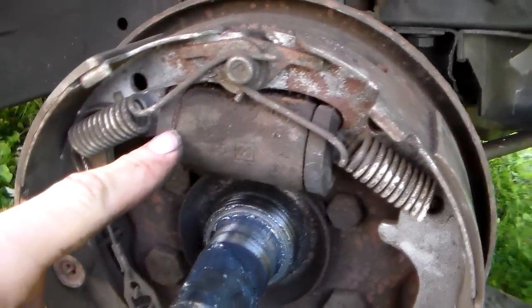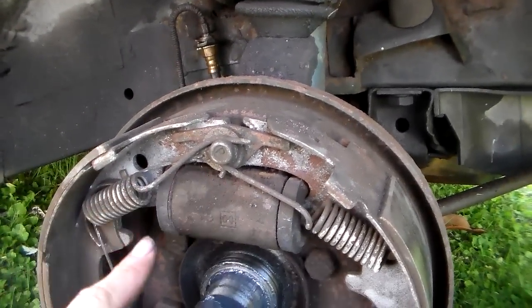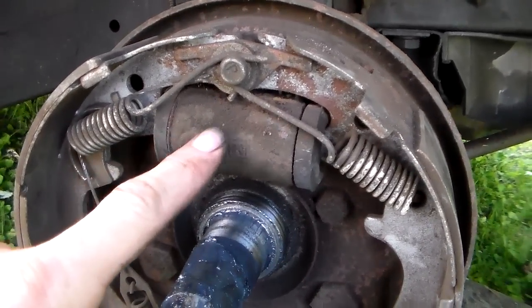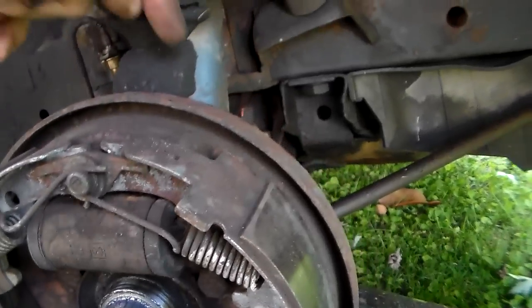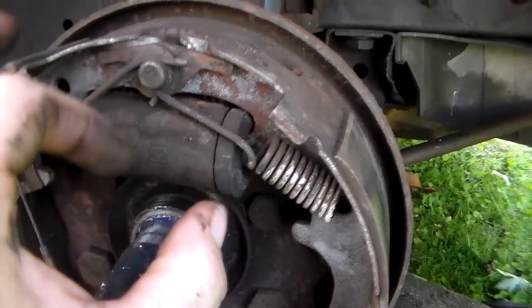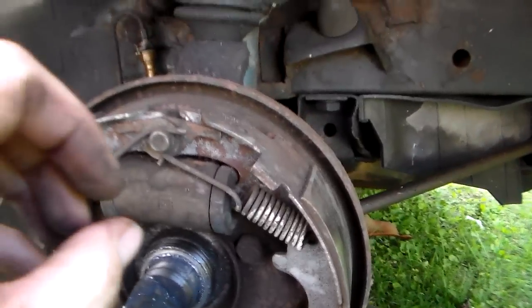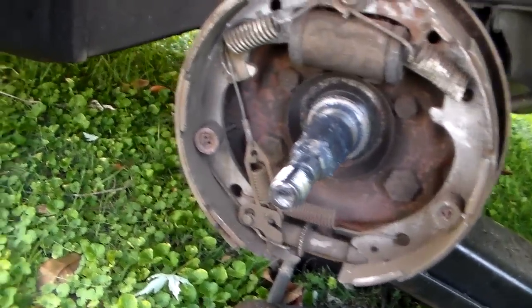What I'm guessing has happened is that this wheel cylinder has frozen up inside. The way it's designed, it's a simple hollow metal piece with a brake line connection on the back and two metal pistons that are a pretty precise fit inside. When you apply brake fluid pressure, they expand outward and push the brake shoes out. Then the springs are supposed to pull the brake shoes back in when you let off. If the cylinder pistons are seized, the brakes drag — which is exactly what we were seeing.